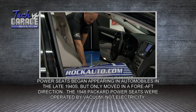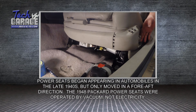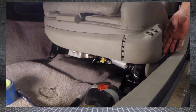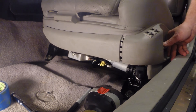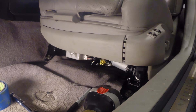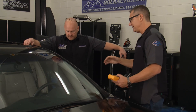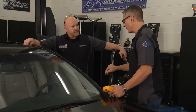Let's verify what you experienced. The lumbar's going backwards and forward just fine — that looks to be okay. But if we try to slide it, there's a crazy twist going on here. No way that's going to work. That crazy twist kind of gives us our strategy-based diagnosis — it's moving back and forth, so we probably have a mechanical issue, a motor gearing issue, but probably not an electrical issue.